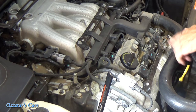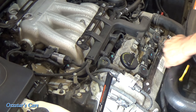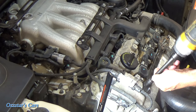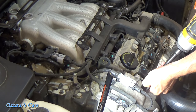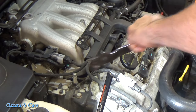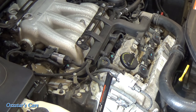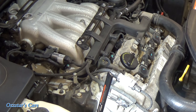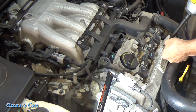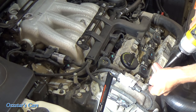To get started, I want to remove this upper coolant hose bracket — these are all 10 millimeter. There's one bolt right here that's holding in this whole entire bracket. Take that bolt out and this bracket comes out like so. What I like to do, so it doesn't get confusing, is put these bolts back in place on the valve cover so when we go to reinstall, we know exactly what goes where.